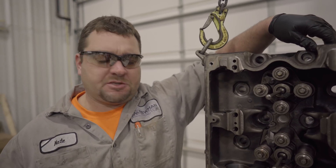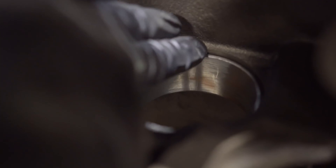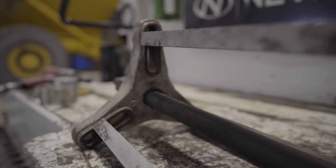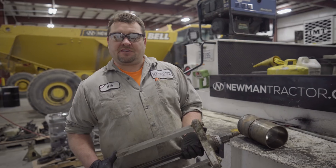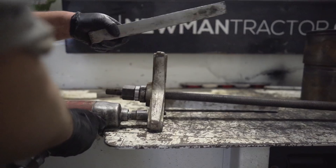The next thing to do is inspect these cam bearings. After looking at these bearings, they're definitely going to have to be replaced. With so many different styles of engines, it would be next to impossible to have every special tool for every engine. So just like the valves, we're going to have to make another tool. This is a tool we use to remove sleeves from the cylinder block — with a little work, I think we can use it to remove and install the bearings as well.